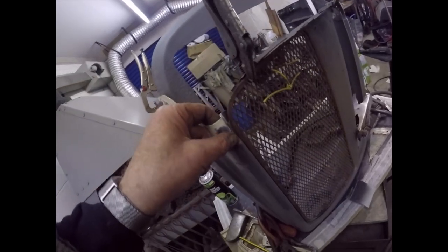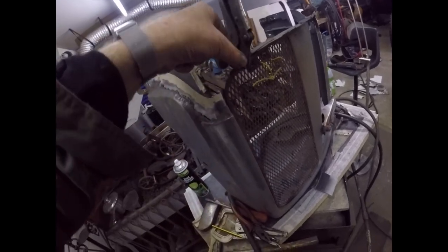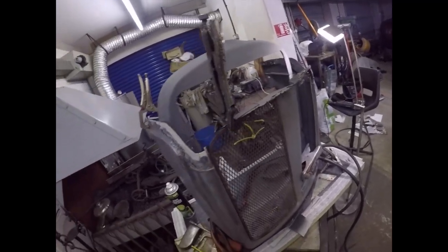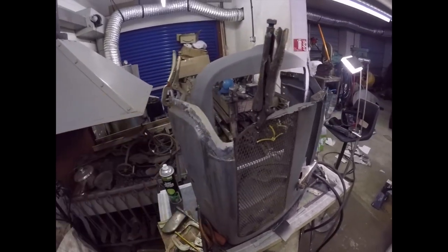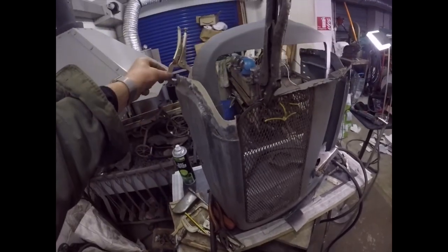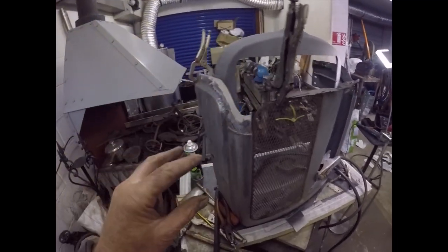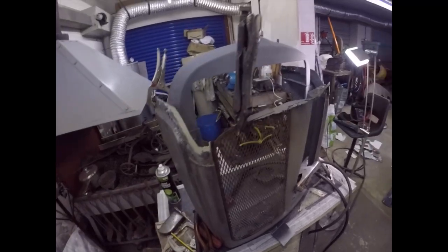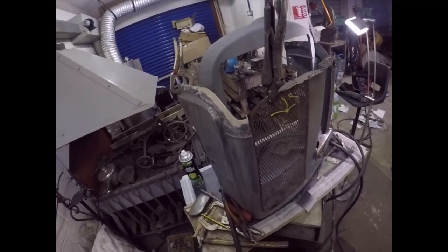Got the bends in there, drawn up to the grille. We just need a little piece around there. Before welding, I'll leave it clamped in place — it often pays to make all your bits of tin first and clamp them in. You need loads of little mole grips; these obstruction mole grips are so useful. Clamp them all in place, and when you're happy, tack the first piece in, check the fit, tack the next piece, check the fit, and keep going. Next piece to make, but first it's dinner time.